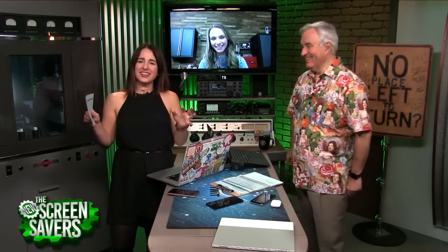With all those pieces, can an average person put it back together? Absolutely. We do these teardowns and then we go back and write repair guides for all the vital components in your phone. You can go in and replace the logic board, the cameras, all of these things. Once you get the display open, it's just a flick of a spudger — undo some cable connectors, carefully get those ribbon cables out. I didn't have as hard a time with the 10 as I did with the iPhone 8. So with our repair guides, you can go step-by-step all the way through and do most repairs yourself.